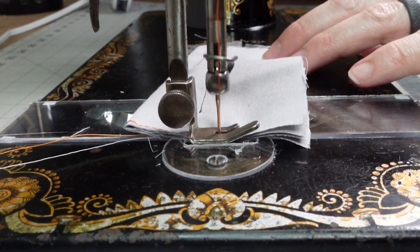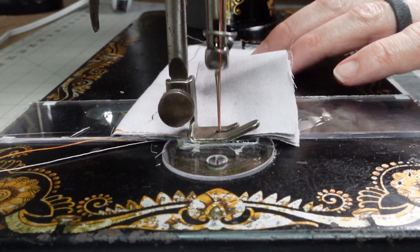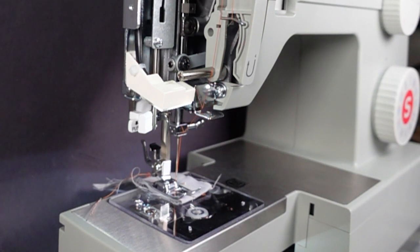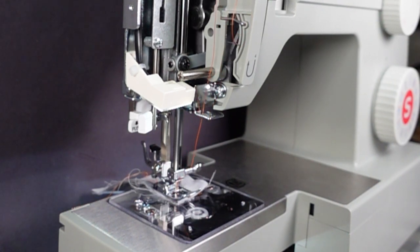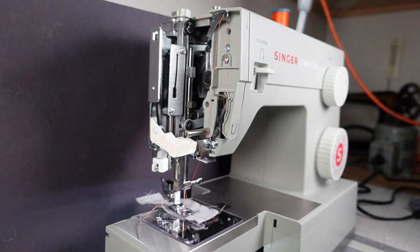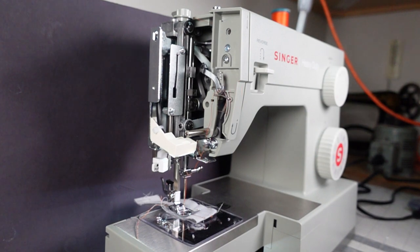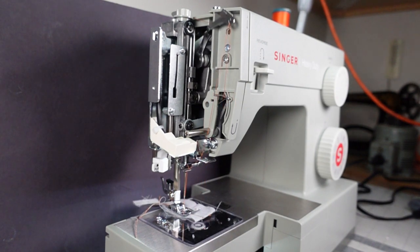You can find all of these components on even the most modern sewing machines. In recent days there have been a few changes to the mechanics of sewing machines — or has there? Here you can see the needle coming down and the hook coming around to pull the upper thread around the bobbin case. The hook and the bobbin case are both what was considered the shuttle on the old Singer. You can also see that the take-up lever serves the same purpose. The parts have different names but still accomplish the same tasks. As for digital machines, I have a video that discusses the differences — it still has the same functions as that old Singer, it just goes about them differently. It's nothing to be afraid of when you realize it has the same function.